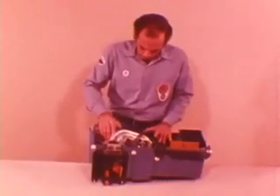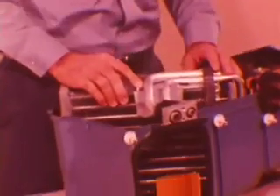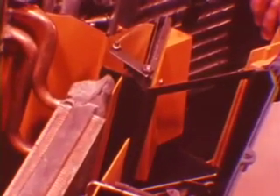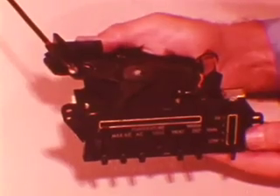With the housing lid removed, the evaporator slides out easily from grooves inside the housing. Foam band insulation assures quiet operation and easy reinstallation. Downstream from the evaporator, the blend-air door controls outlet air temperature by diverting all or part of the airflow through the heater core. Door action is controlled by the temperature lever, which is connected to the blend-air door by a cable.